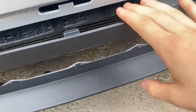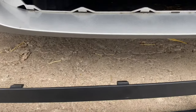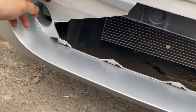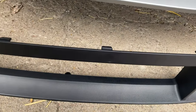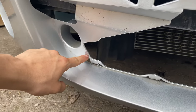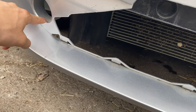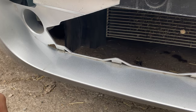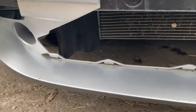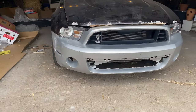I'm going to play around and see what I want to do — I don't know if I want to cut this or cut my bumper. The CJ Pony Parts bumper they send you for a front-end conversion swap has versions without holes and versions with holes, and they also send you this exact piece, so they're saying this should fit together — but it doesn't. It wears right along here, so I might have to cut that off, preserving the press-in hook, and cut off some of this piece. I'm thinking from about here to about here, working on this side to see how it feels, and if it snaps in, do the same on the other side.